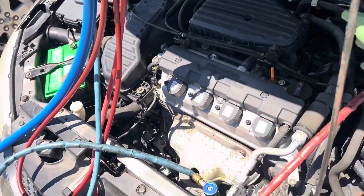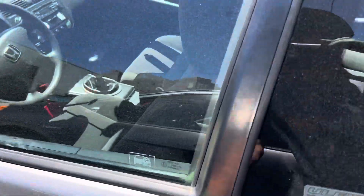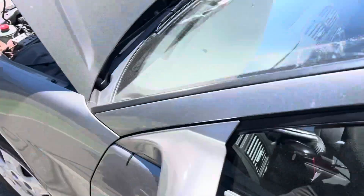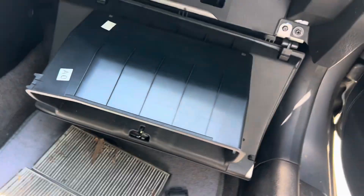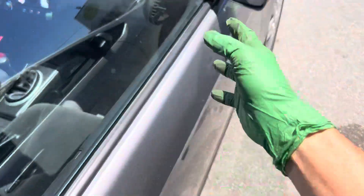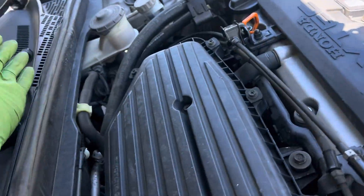Let's switch it because we've got a hot engine, hot exhaust manifold, and air blowing over the fresh air intake. Let's put some hot air from outside because it's starting to cool off inside — I want to put more load on this. It's under 100 inside now, so let's take this out of recycle and get some hot engine heat to load up that evaporator and drive that high side up. This is the kind of experimentation you want to do. I don't want cool inside air — I want the hot stuff. Boom, now I just stopped the inside cool air and I'm taking this hotter outside air.